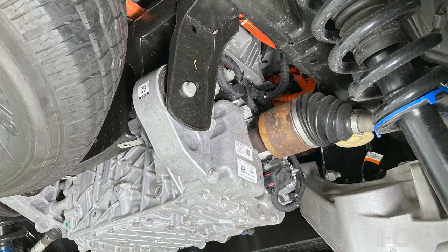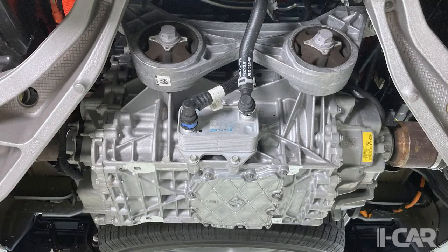A little closer look at the rear drive motor assembly. Up on top of it sits the rear inverter. So they run high voltage DC out of the high voltage battery back to that inverter unit. What do we have on the back of that one? Can you pause that shot right there for just a moment? So here we have an oil to liquid coolant cooler. We have oil inside the gearbox, inside the differential electric motor back there. And then to cool it off, we run it through this plate cooler, which is circulating liquid coolant. That's controlled by those water pumps and has a heater and a coolant loop in there so it can heat or cool that down to the proper temperature it needs to.